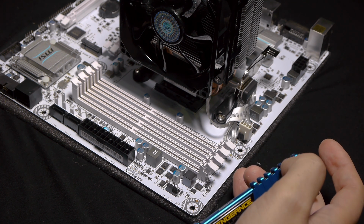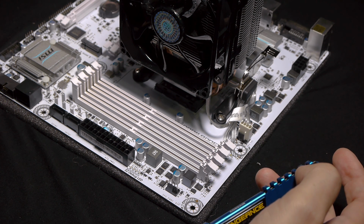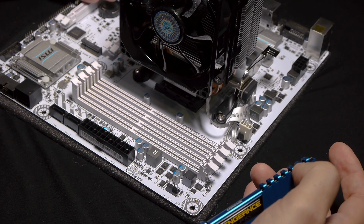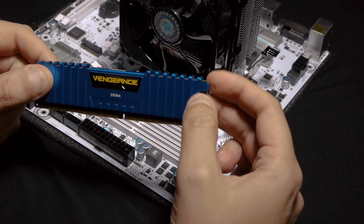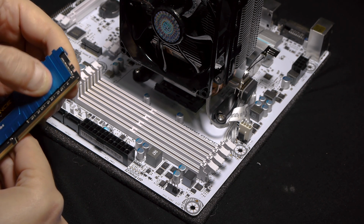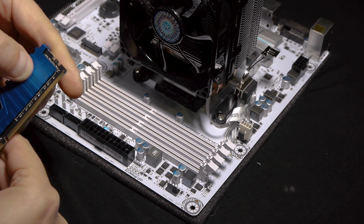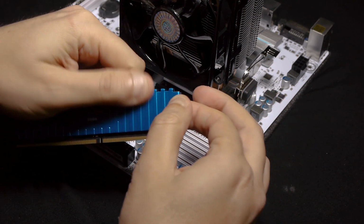and then you go to the RAM section of your BIOS if it's a UEFI BIOS, and activate the RAM boost or the RAM overclock or whatever it's called. And in most of the cards, like is the case of this card, you can choose a profile of overclock or the profile RAM boost. In my case, I can choose profile 2, and it will find the RAM, it will find the Corsair, and it will find the speed that is 3000, and you say, okay, this is your profile 2, this is your card, this is your RAM, MSI 3000, and it will activate the 3000 RAM boost, and the RAM will then run on 3000 hertz.